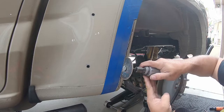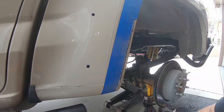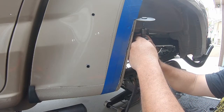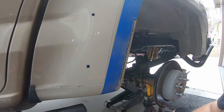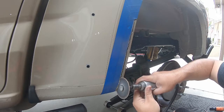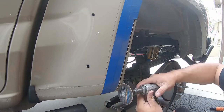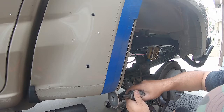A cutoff wheel generates a lot of heat and friction as the blade contacts a lot of material at high speed, whereas a reciprocating saw only has the thickness of the blade — much smaller. I've left a nice sixteenth of an inch of material away from the final cut line for two reasons: first, I want an error margin I can sand off; second, that extra heat will cause the paint to peel up at the edge. I want to remove that peeled paint so the sealant on the outside prevents moisture from causing rust or future delamination.